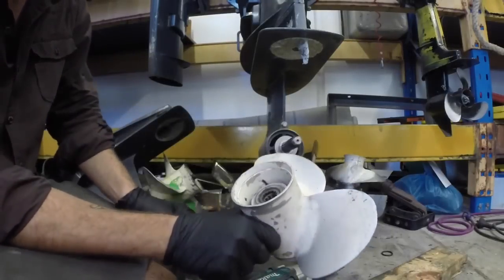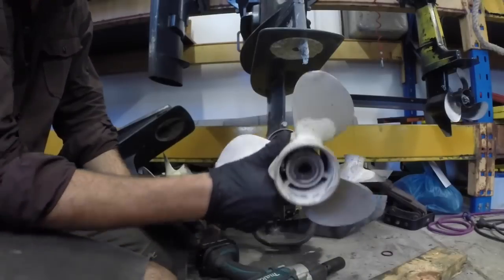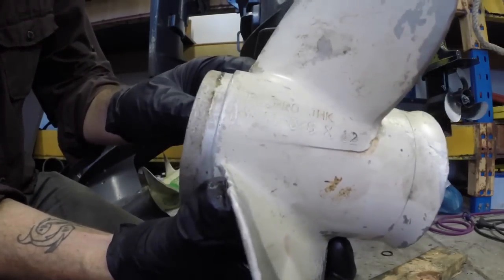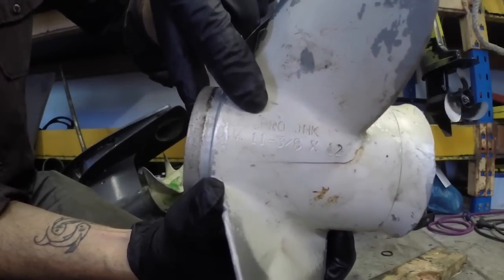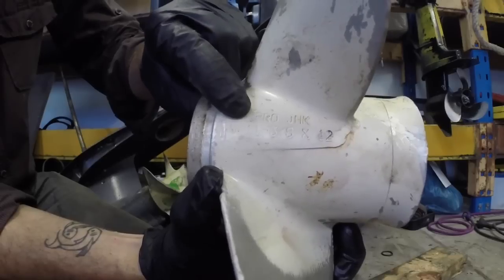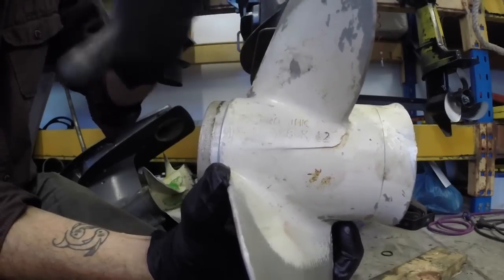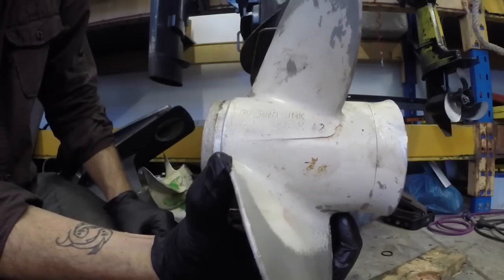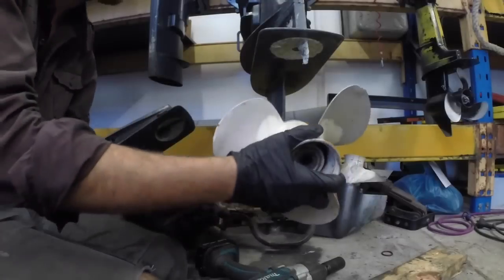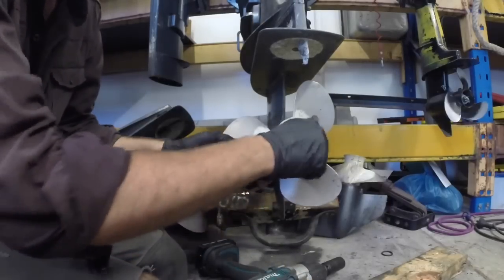Now at this stage we're putting our new prop on. I've still got the old prop for the boat from the intro in the workshop so we'll have a look at that in a second. Just grab the new prop and slide it on. On the propeller it says here a couple of measurements — so this is 11 3/8ths by 12. The first measurement is the diameter of the prop, and the second is how far the prop would move forward in one rotation if it was in a solid with no slippage. Those are the two main measurements for a prop, as well as whether it's left or right handed and what it's made out of. So just make sure you get the right prop when you order the replacement. Slide that on, add our spacer the right way, and then do this nut up.